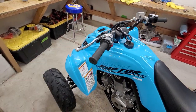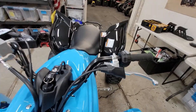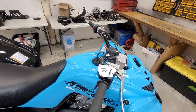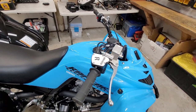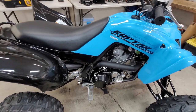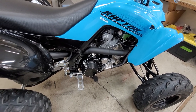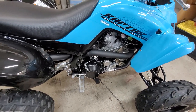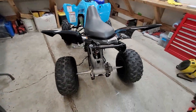The main thing is it pulls the clutch cable properly, the right length to release the clutch all the way so you're not dragging the clutch. ASV levers, pretty much everything on the market will not pull the clutch cable as far as it needs to and kill clutches, overheat clutches. So speaking of clutches, inside the direct drive cover, we have a mechanism there putting additional clutch pressure. We did do a full fiber modification to that setup. We are on factory springs because we have a lockup.